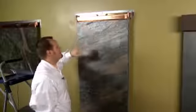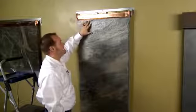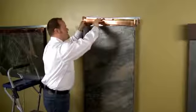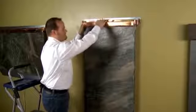You can see how the water distribution unit sits on top of the stone. And what we're going to be discussing here is the gap that is between this lip and the stone. To adjust the water distribution unit to make it fit snugly against the stone, you need to lift the water distribution unit up and firmly press the lip with your thumb. Now this is going to form the copper piece to the stone. And this can be checked by just putting the water distribution unit right back on the stone.